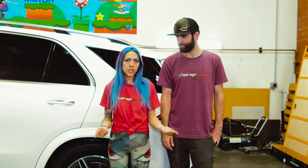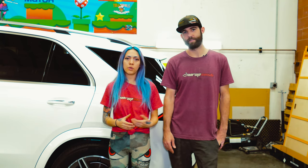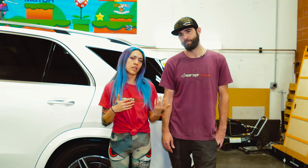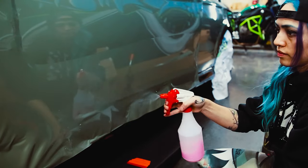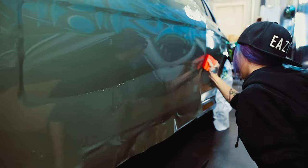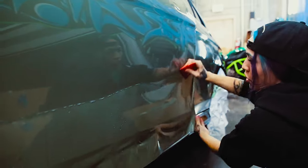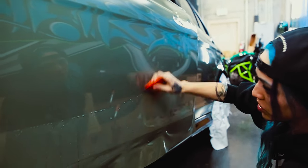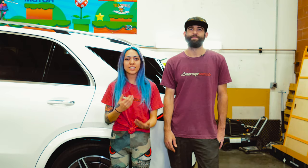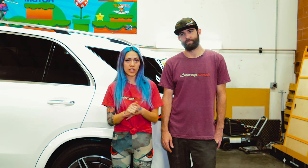You can install with the cover film on, but you can't do a lot of conforming work with it — it doesn't bend well and it's super thick, not like the 3M cover film. What we actually like to use is a lubricant: Superior Image Car Care Show Shine, the pink spray, or Body Shine. It's a silicone-based detail spray. When installing, to avoid scratches especially on gloss, we'll spray the top of the vinyl and spray our squeegee — it creates a nice buffer to glide on.